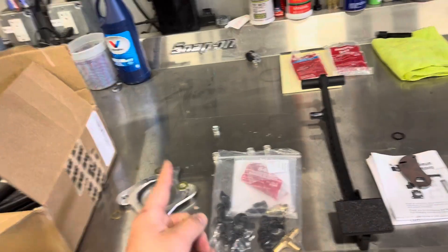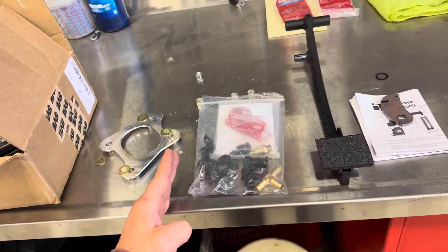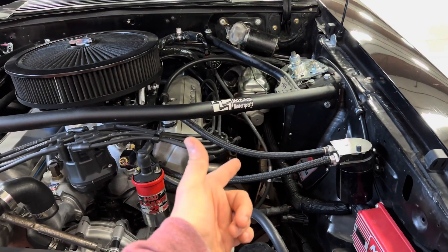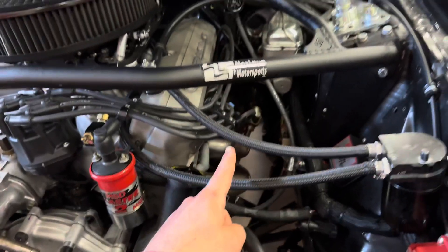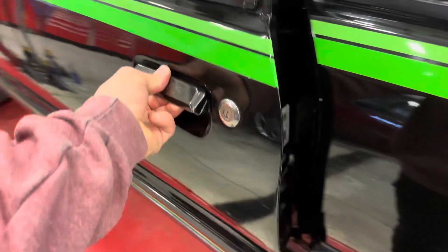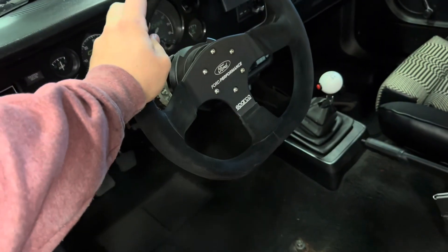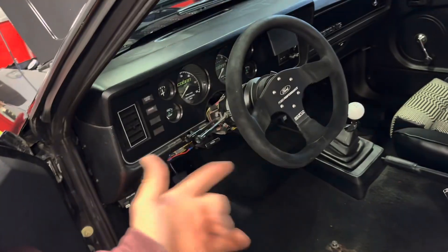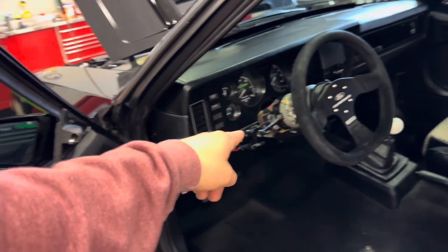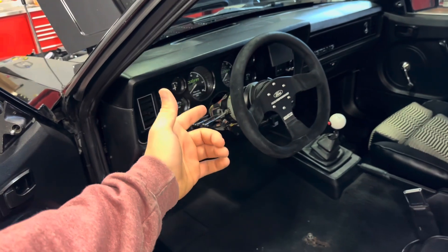We're going to try it out — everything looks the same but you never know until you start tearing it apart. The first step I'd recommend is taking off your master cylinder and the lines going down to your proportioning valve. Then out on the steering rack at the slip joint, take out that bolt, because you will unfortunately have to take out your steering column. You got to do what you got to do to have awesome brakes.